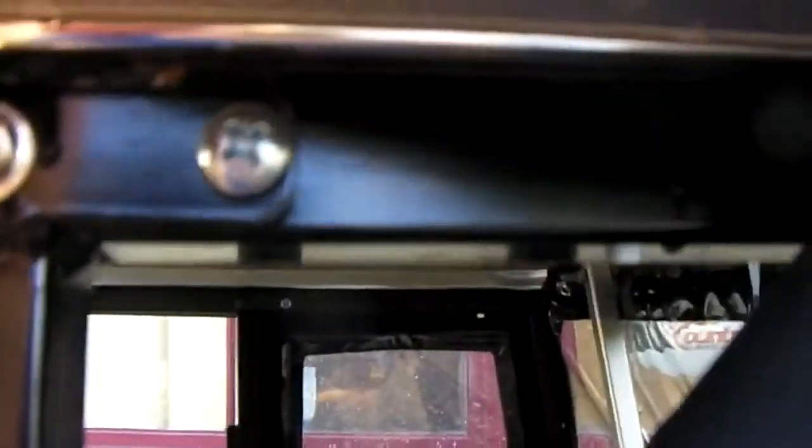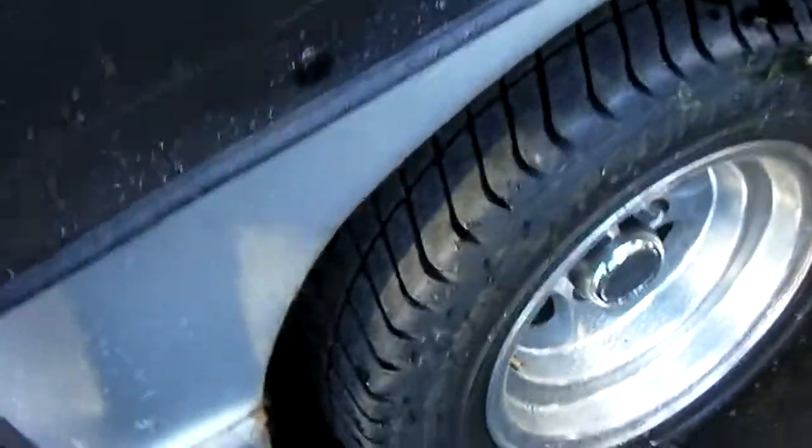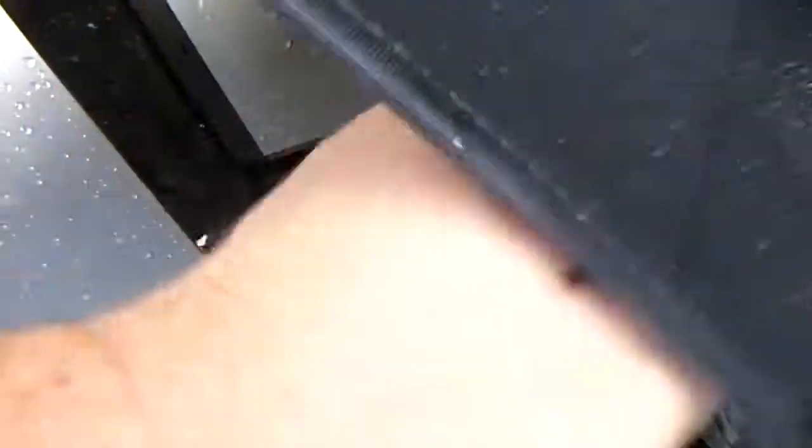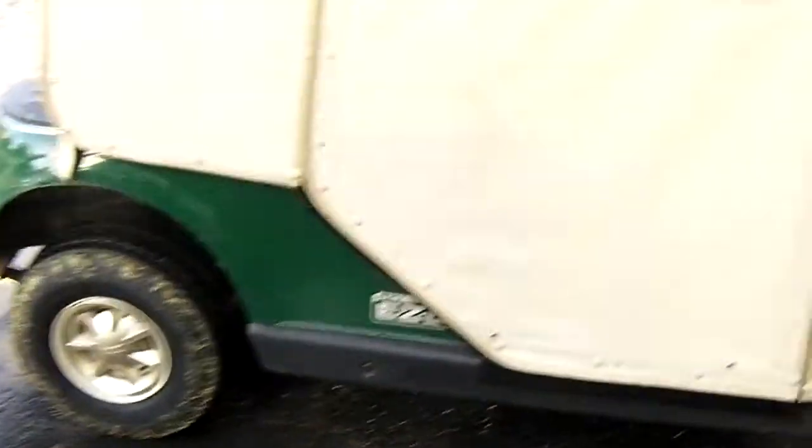The RXV is probably the easiest cart to put the Cozy Car Enclosure on. The Yamahas — we had to manufacture a couple little parts, but nothing too big of a deal. This also has the jointed frame — right there and down here. It's away from the body, so the nut can go towards the body. Put that round surface towards the body and maybe run a little file over it or sand it down and smooth out the burrs. It doesn't chafe the body as bad — the frame fits tighter to the body on the RXV side.